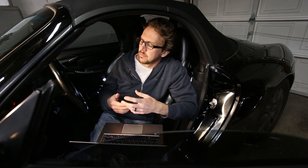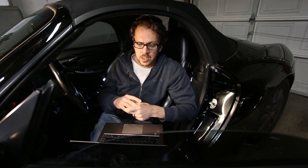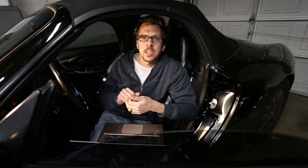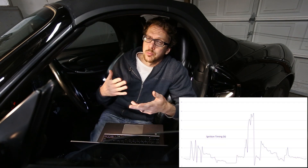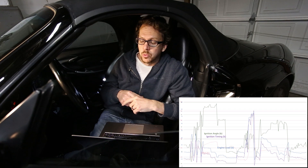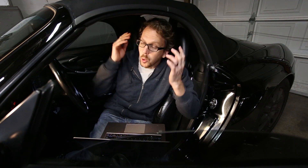In addition to all of that, the Durametric software also logs actual values. What this means is that you can drive your car with this cable attached and actually log and save data on just about anything — mass airflow values, O2 sensor values, RPMs, engine load, timing — you name it. I've done a couple of videos on octane and engine knock, and I logged values and put some charts up on my blog. I'll include links in the description or the cards. It's a really awesome tool — you can see in real time what your car is doing and what each sensor is reading out. You can save that all to a file, turn it into charts, and really just totally geek out.